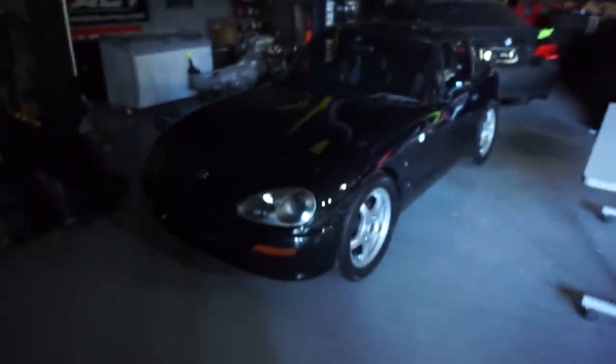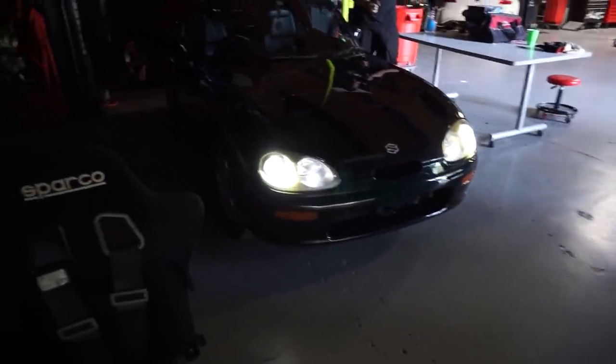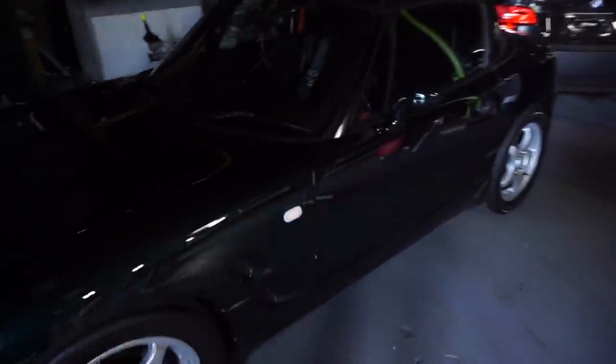Chris actually changed out some of the bulbs around the car to LEDs as well, which is pretty cool. We're going to light this thing up and show all the features and where the cutoff is. Some of you guys that like to do headlights can see that we've aligned the cutoff — it's about 21 inches from the floor, which looks really great and really modernizes the front of the car. It's a much wider light than the yellow stock setup. We've also upgraded the turn signals and the daytime running light.